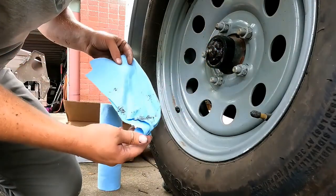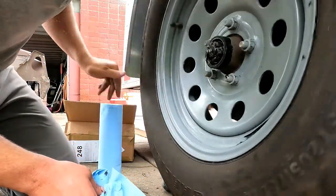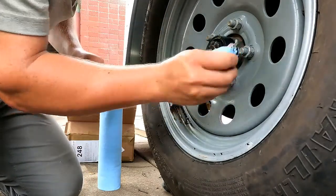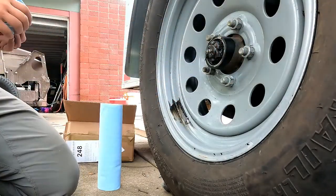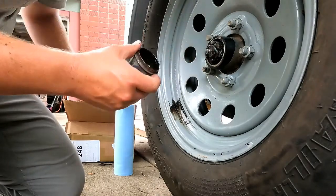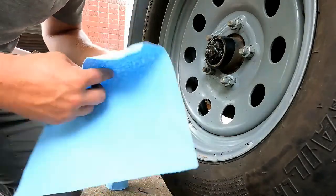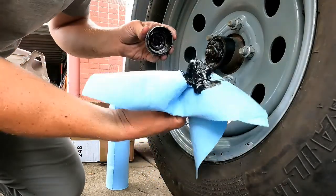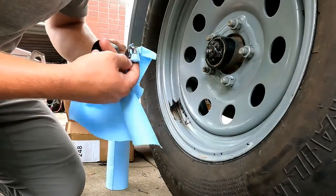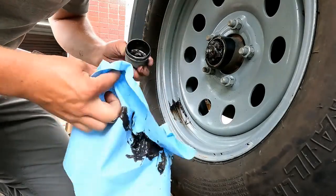This kingpin is loose. I'm not sure if that's intentional — it's torqued to factory specs and I don't feel a lot of sideways play. I thought that was the bearing grinding, but actually that's probably the brakes, so we're probably in pretty good condition there. Should have cleaned this up and slapped this cap back on. Looking pretty good, pretty happy with it so far. We're using probably a little bit more than a third of a tube on each hub. These grease caps are pretty nasty too, so I'm cleaning those out and trying to get them as clean as I can. People say not to leave too much grease in here because it can cause overheating if there's not enough of an air pocket. So we're going to clean as much as we can, get all this liquefied stuff out of here, and hopefully these don't leak on us. Then we'll go to the car wash and power wash off all the extra grease.